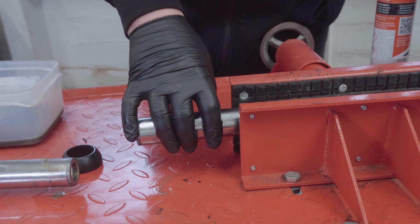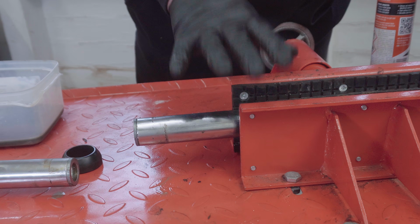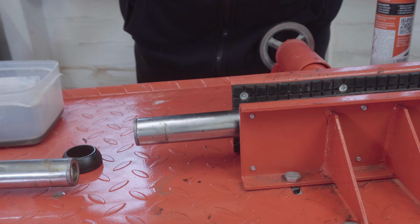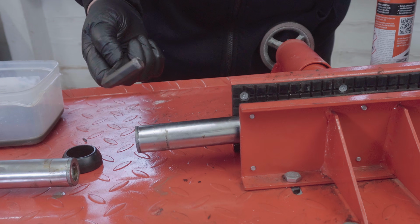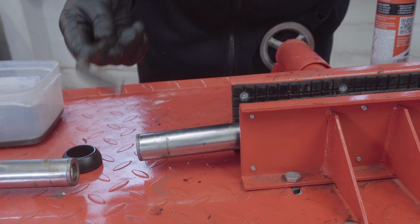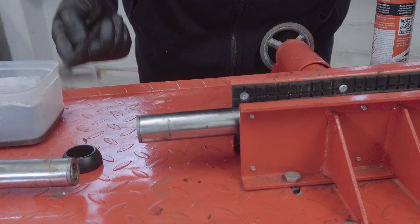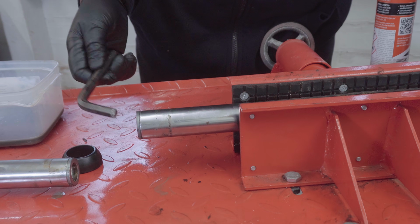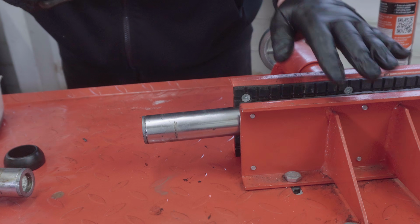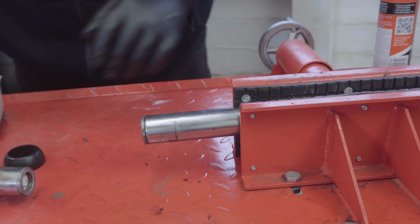If you are clamping these, and you should do, make sure that there's some cushioning. But another thought is, if you've got the yokes off the bike, you could put it in the yokes while you do this. Now I'm using an 11mm Allen key, which you won't have in your set. I think I bought this specially. It might be Imperial 11/16, but I'm not 100% sure on that, but an 11mm will do it. I think I may have already started these off while it was in the yokes, so they're not going to be difficult to take out.